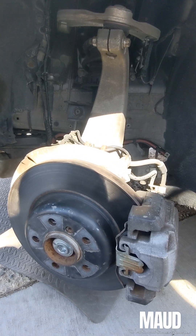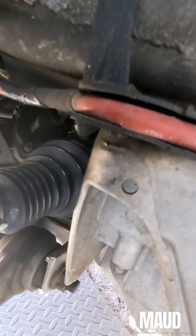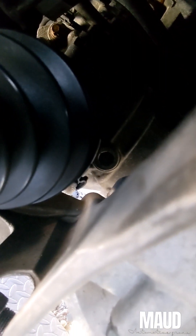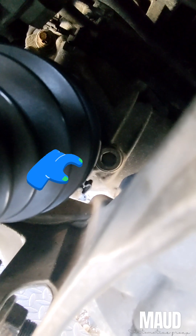With the wheels off, we have to go behind the CV axle on the driver's side — right there you can see the fill plug. Underneath the car, also on the driver's side with the underpan off, you're going to have your drain plug. They recommend replacing your plugs when you do a fluid change, so I do have new plugs ready.